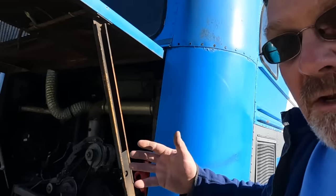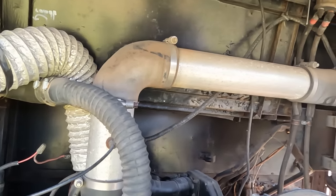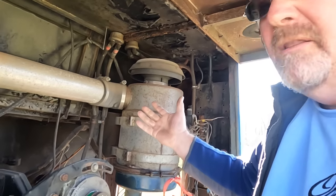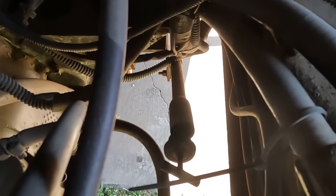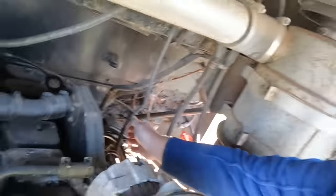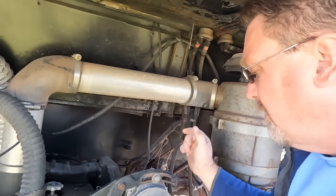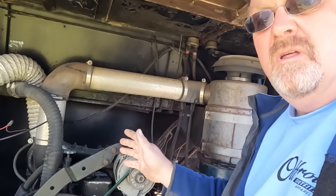Doing my pre-flight checklist. I went to look at the air filter minder — I figured it's got to be good since it has a new filter, but it wasn't — we're back to red again. I'm going to reset it. I really don't think there's a clog in this tube since nothing got past that air filter. There's a possibility this system is just sized for the original engine, and this motor sucks more air than the original did. There's nothing I can do about it — I know there's a new filter, so I'm going to ignore it. The coolant level looks low, so we're going to top off that tank. The transmission dipstick popped out again — we're just going to push it in and ignore it, because if there's a clogged vent, that might be the venting, and I don't want to overpressurize the transmission. The belt seems still plenty tight. Engine oil looks good.